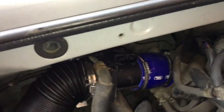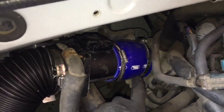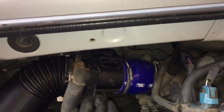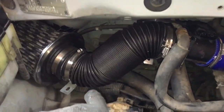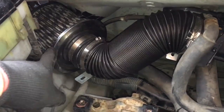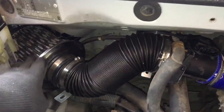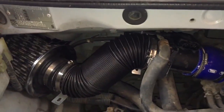One is that I've got a true 70 millimeter silicone air intake joint now, and instead of just being straight, it actually has a flexible elbow built into it. So hopefully I can get the mass airflow sensor pointing straight and get rid of some of this awkward kinking out of the universal joint. The second thing is that I have sourced a very small pod filter, which hopefully will poke much further down into the cavity and much closer to the air intake as a result. I will put links to both the small air filter and the 70 millimeter silicon hose into the description.